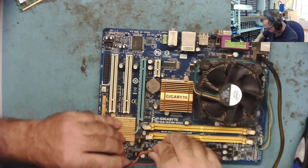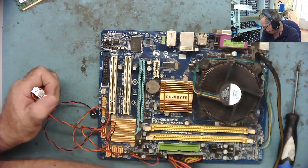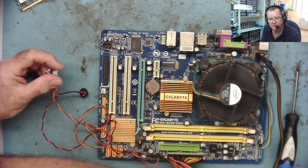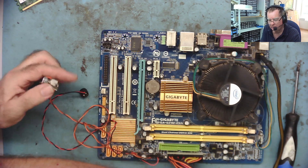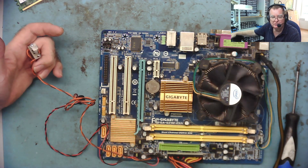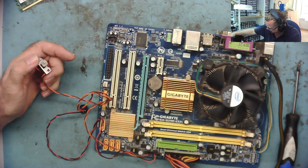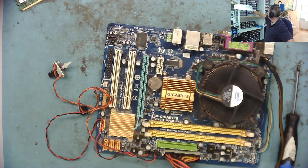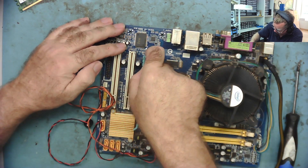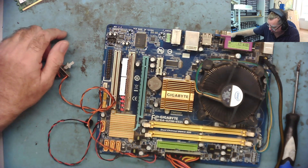So no RAM, just the motherboard. The power switch should be there. Power's on - it powered up on its own, and nothing. I'll hold the switch and shut it down. This motherboard's not behaving very well, is it? Let's try starting it myself with the switch. I'll get the POST analyzer card in as well and see what that thinks of this motherboard. All zeros - nothing.